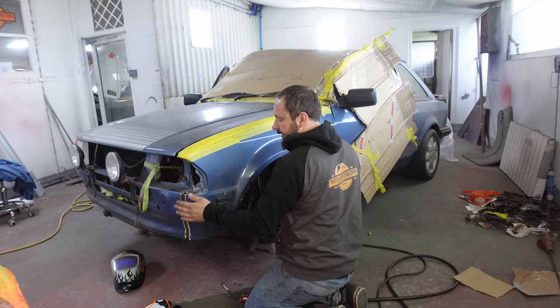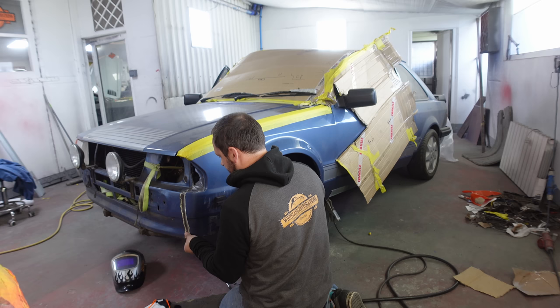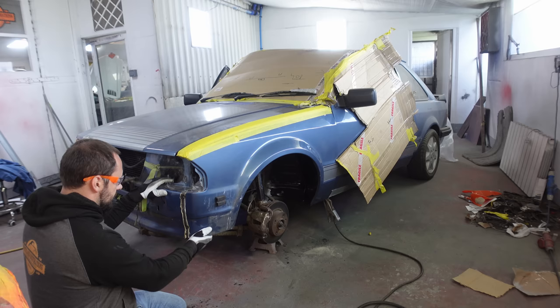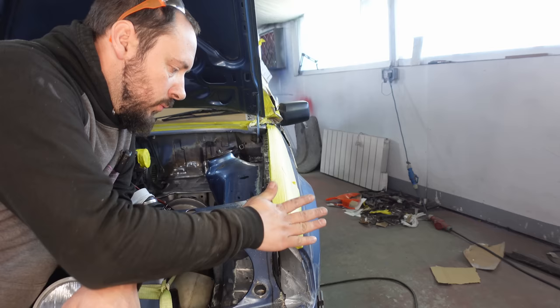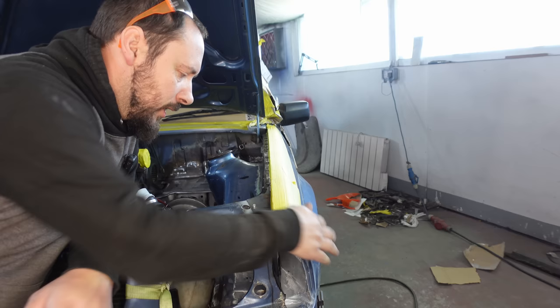I think I'll start here because that's kind of got to fit there — where we've sliced it off at the front we'll just butt it right back up to that and stitch it right back into place, then work the rest of the wing around that. They will hold it — very nice, it's gone right back in the right place. Now we'll push and hold this, maybe get a clamp or a tack in to hold it exactly there whilst we tack it. I managed to open the bonnet and hold it roughly where the wing needed to be, and got a screw bolt in with the bonnet open. I'm not sure if it's exactly in the right place but I'm sure it's in the ballpark — let's shut the bonnet and see.